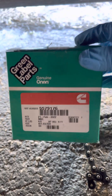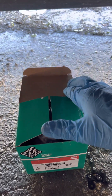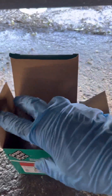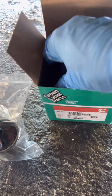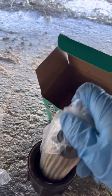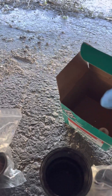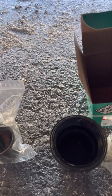This is the part number for this filter. It's a 2019 Kenworth T680 with a Cummins engine. So this is what you will get: you will get this rubber cup — this is the used one, I just put it back inside to show you what the kit looks like — you will get this cup and filter, and you will also get a little lubricant that you have to use to lubricate the O-ring.